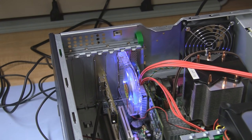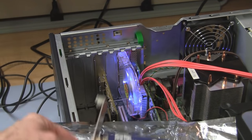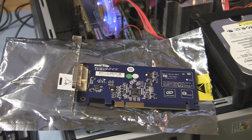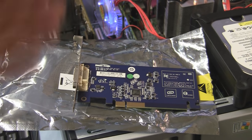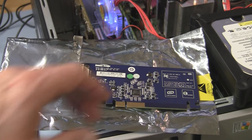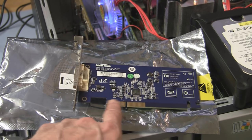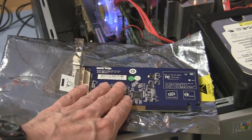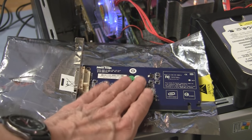That's a good introduction. Just be very careful — there is an existing video card in the PCIe x16 slot. You'll have to take it out. That is the video card that's in there when you get your DC 7700. You'll carefully remove this video card and put your controller card in its place. This particular controller uses x8 — it only uses 8 of the 16 lanes. The video card is also inexpensive and may only use 4 lanes. We're going to take it out temporarily, put in the SAS controller, and then when we're done, put the video card back.